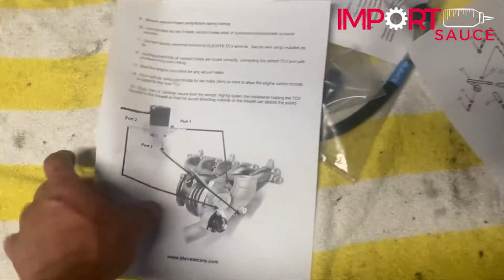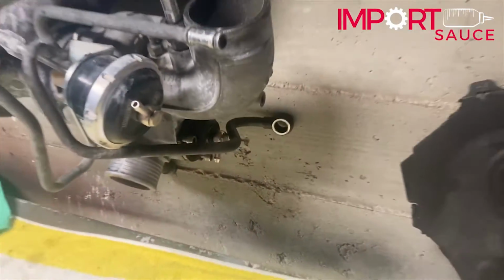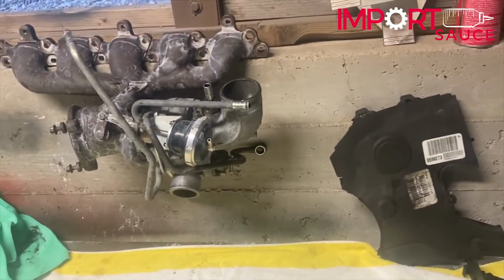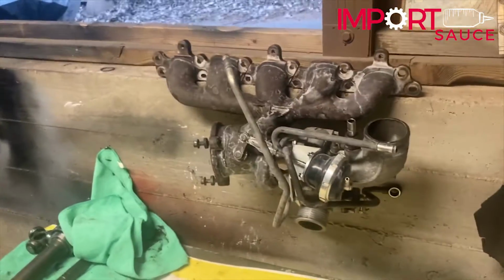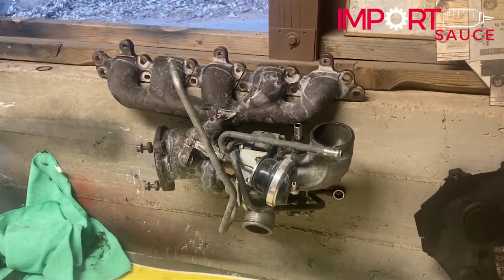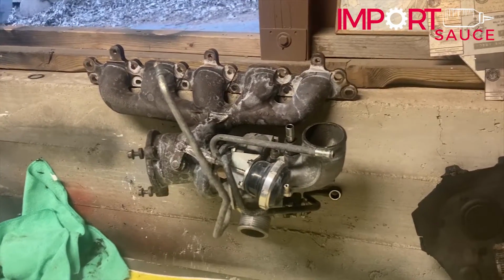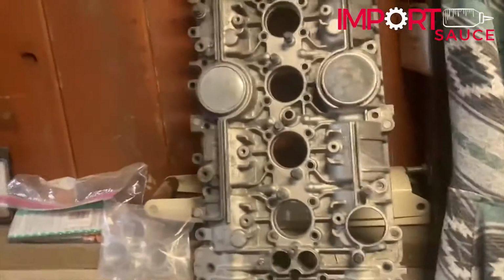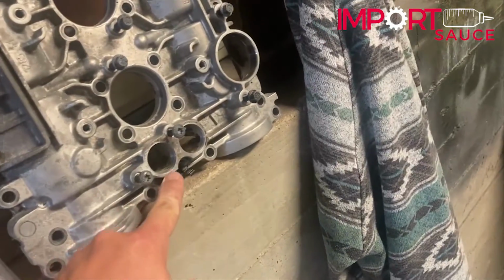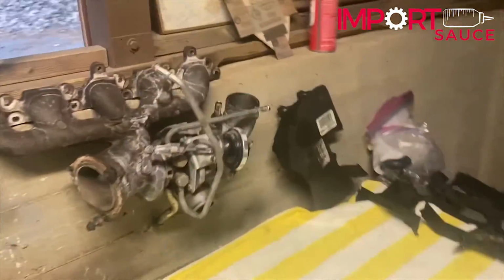So this is cool. We're going to put this aside because as we are putting this car back together, we just unplugged everything. And you might be saying, well, wait a minute, where does this extra one go? This is a 4th hose. That one reconnects and goes all the way back up to the front of the head and links in there. I don't remember exactly, but if you've installed a turbo pressure gauge, then you know the line that you tee into is the one that goes up and through. Actually, let's take a look here. It fishes over and runs inside under the plastic timing cover.